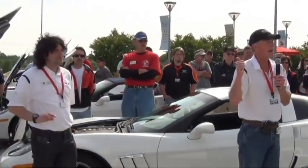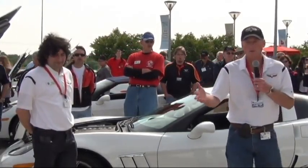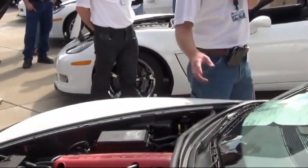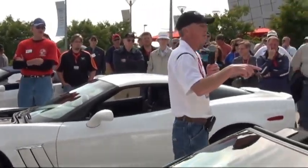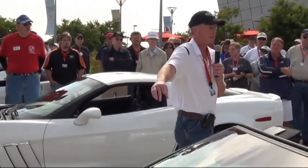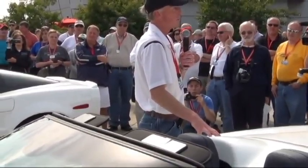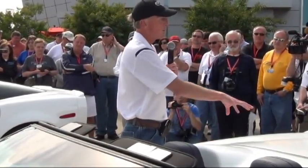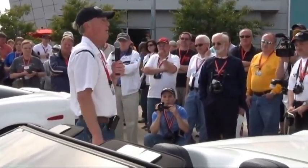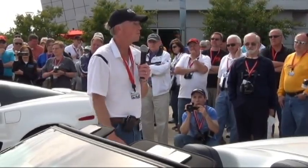That steel frame is a little heavier than aluminum, so we added carbon bits to try to take the weight back out. The trickiest part is honestly doing the dry sump, which goes up front and displaces the battery, pushing the battery to the back. That sounds straightforward but it's not, because now you've got a big battery cable that has to run the length of the car through all the mechanism that makes up the convertible top. That was actually the biggest engineering challenge — but in terms of structural reinforcements, it's plug and play.